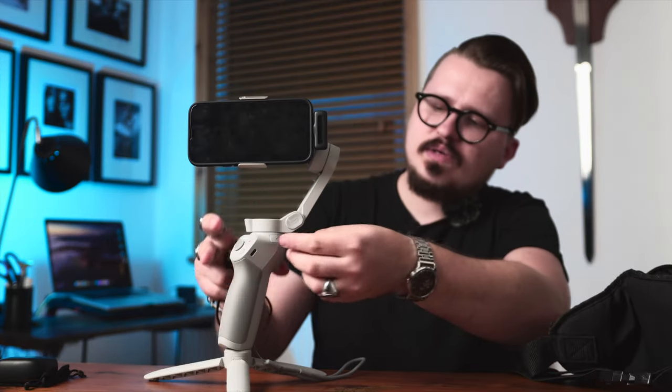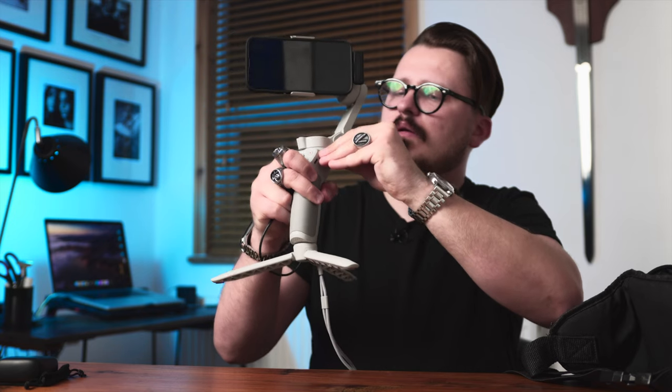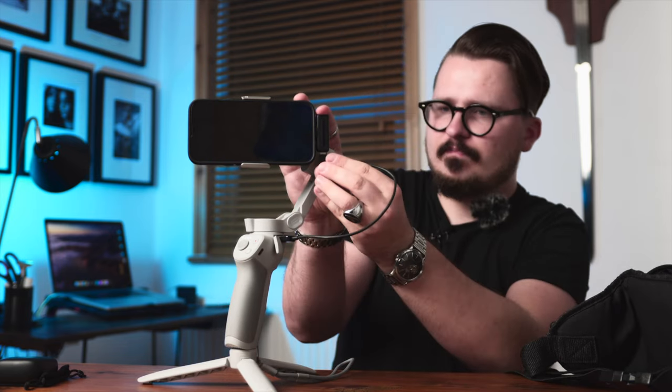The receiver has a built-in lightning port so you can charge the phone and use the microphone at the same time. You can plug the receiver directly into the phone charger and a socket, or into the gimbal, or into a power bank. When using the gimbal, the best way is to plug into the gimbal and then power the gimbal separately — charging everything at the same time. This is the dedicated charging cable for the DJI Osmo Mobile 4 that I bought from AliExpress for about £3. We plug one side into the gimbal's USB port and the other into the receiver, and now the phone is charging from the gimbal.